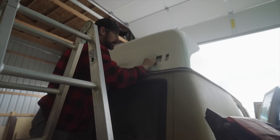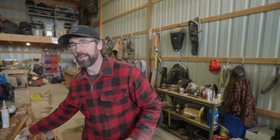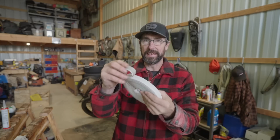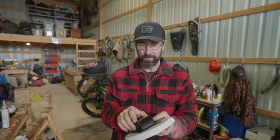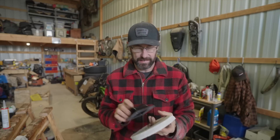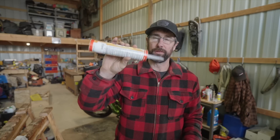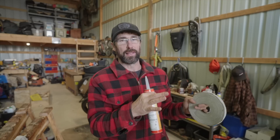I've got the holes cut now and I've already gone up there and cleaned the area really well with some alcohol-infused wipes so that we get a good adhesion with the butyl tape. That's what's going to go on next — it's basically a putty-like tape that will go on around all the edges, and then we can go ahead and push and adhere these on. As an optional step I am going to put some screws in — I've always used screws so I'm going to go ahead and use a couple. Then we'll follow that up with putting some self-leveling lap sealant over the top of everything, and then once they put the Line-X on it, it will cover that and it will be really well sealed.